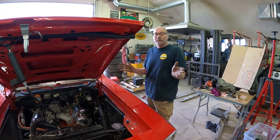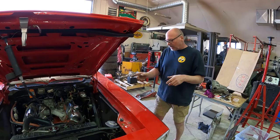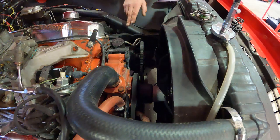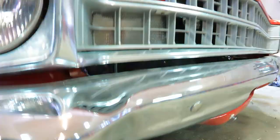So we're just going through the car, figuring it all out — what does it need? Make it safe. One of the things we need to address is a timing cover gasket behind the damper. It's leaking down below, can't see it here, but it's coming down. It's got the deep sump, large capacity oil pan on it, so there's not a lot of clearance there — especially if the front end comes up and wants to come down rather quickly.